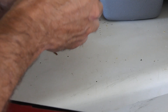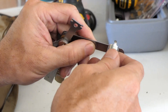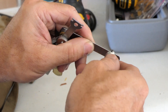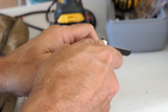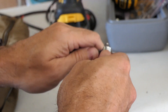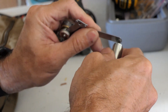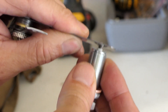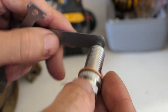There are a lot of different ways to close the gap. I'm kind of old school — I use the tap-it-on-a-wooden-countertop method and just slowly work my way into it, and that works 99% of the time. Just gently tap. If you tap too far and close it up too small, you can use the spark plug tool to open it back up. Just be really careful with that center electrode and make sure you don't damage it. There's probably other ways — I know there's a special tool — but once I get it to 0.024 I'm good to go. I do this on all four plugs.